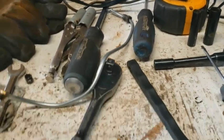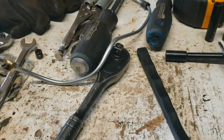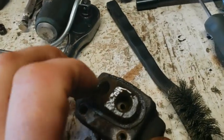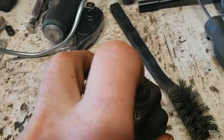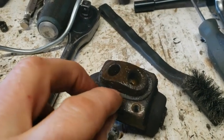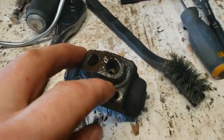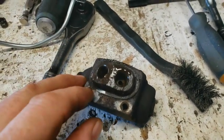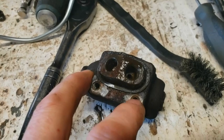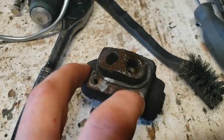It's so cold outside that I'll just go through the procedure and tell you — it's pretty simple, not something you need to be shown. You'll take your wheel cylinder, put in your bleeder screw ahead of time. There's a gasket here with your new one — don't forget to put the gasket on and make sure it's flat. It's kind of difficult to get it to lay flat at first, but just work at it. You've got your two bolts here — I got them out surprisingly after heating them up. They're still sort of good. The nut size is 5/16ths.